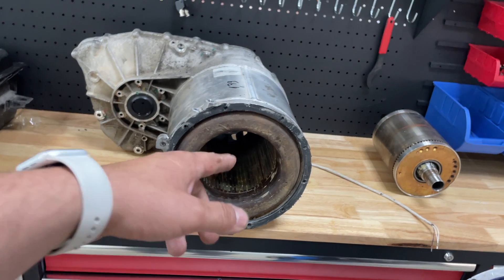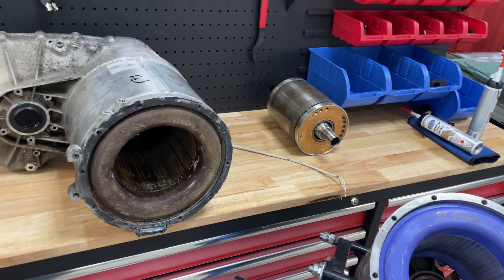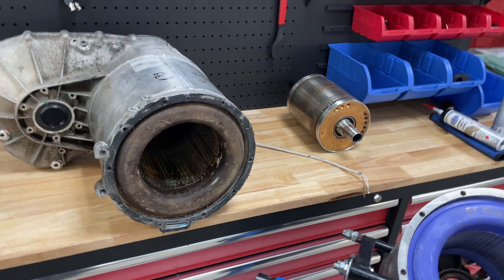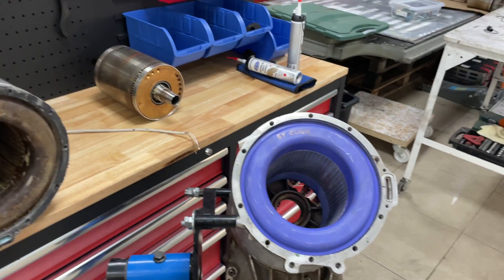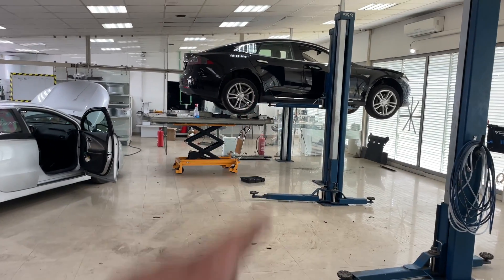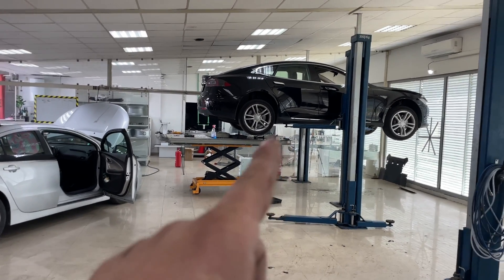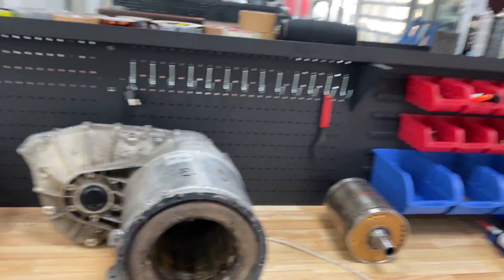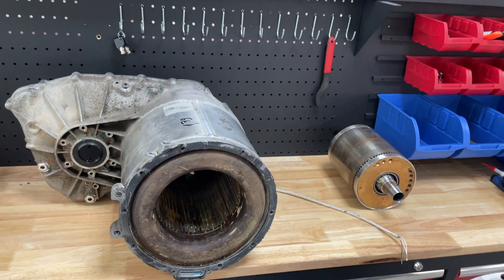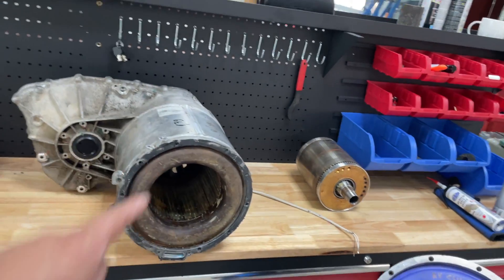If any quantity of coolant penetrates, you get a complete isolation issue — around 1 megaohm — and the minimum is 5 megaohms for the system to work. This is an example of a Tesla with 600,000 kilometers on the original battery that we are repairing now. The first drive unit failed around 500,000 kilometers, and we've found other cases failing around 300,000–350,000 kilometers on the first powertrain.